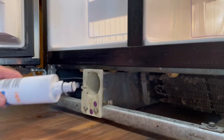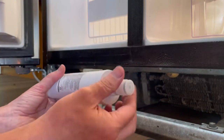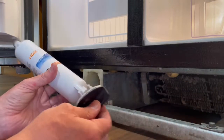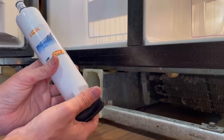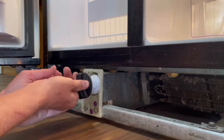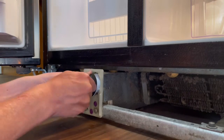Take the new filter — it has a black plastic cap on it and two rubber gaskets. Pretty simple: take this black plastic cap and slide it on the end of the new filter, put it back into the housing, turn until it fits in, and then turn it clockwise until it stops.